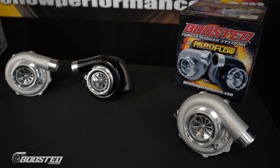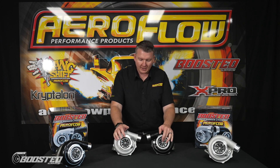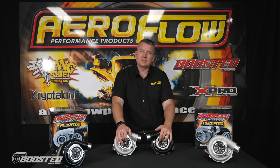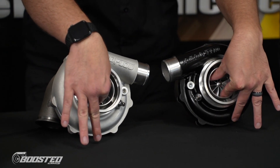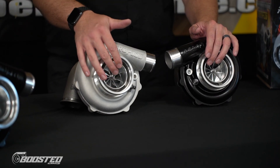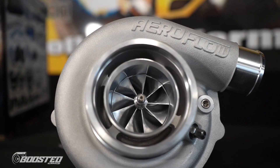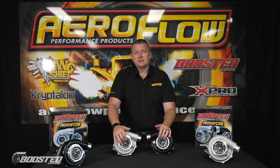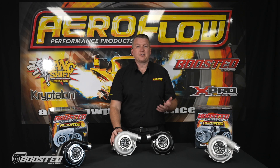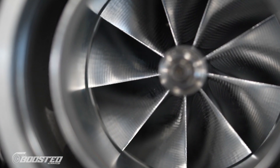To walk you through the turbos from their actual physical properties, let's go from the front to the back. Both of these turbochargers have 62mm compressor inducers — that's the front of the compressor wheel. That measurement across the front of the blades is called the compressor inducer, and it is 62mm. It's made from 7075 billet alloy, which is an aircraft grade aluminium, CNC machined on a five-axis machine. Then they point mill the compressor blades — you can see those little dimples and grooves on the front of the blades. That's called point milling, which is an aerodynamic advantage when spinning those blades at very high RPM, allowing them to operate more efficiently.